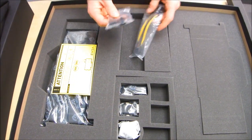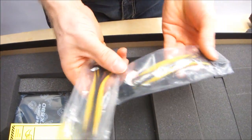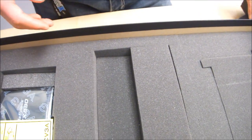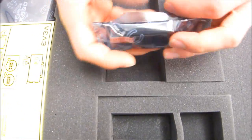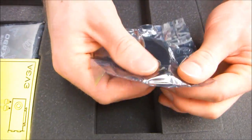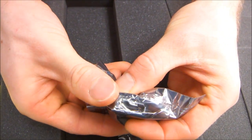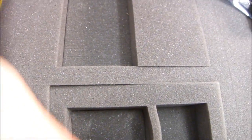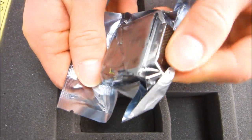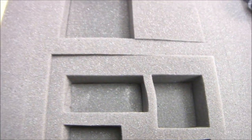So let's look at the accessories first. We have two 6-pin to one 8-pin adapters — we've got two of those. So if you have an SLI-ready power supply that's older and only has four 6-pin PCI-E connectors, you will still be able to connect the Classified to the 8-pins. We've got a mini DisplayPort to full-size DisplayPort adapter, a DVI to HDMI adapter, as well as a DVI to VGA adapter. And please don't use VGA on this video card.